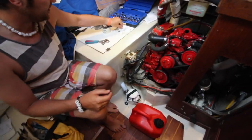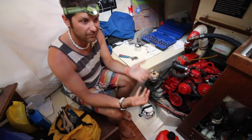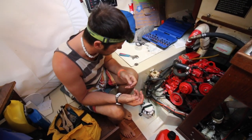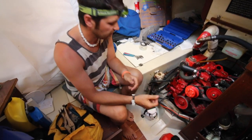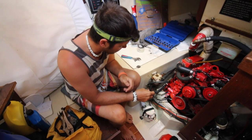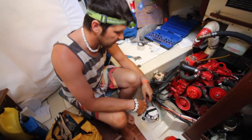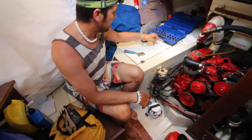So we're going to replace all three of them and it's a little messy. Every one you open up, fuel dribbles out into your hands and you're spilling everywhere. The other problem is you have to refill the cartridge with diesel fuel when you put it back in, so you're trying to pour fuel — and in here it's even more of a nightmare — but we're going to have at it.